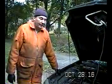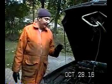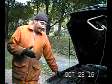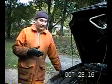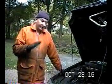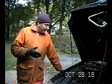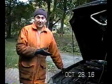So, okay, I have removed all 10 head bolts from the car, and all of them look surprisingly good. I didn't see any aluminum shavings. They were really remarkable. And just because I'm not really sure what to expect and how long this car's really going to last, the body looks like shit. It looks like it's got leprosy anyway. I think I'm just going to go ahead and put the regular head bolts in. Now, I know there's a bunch of people that are going to get pissed off when they hear that. They're going to say I need inserts or studs or whatever. That's true. But just for this job, just for shits and giggles, I think I'm just going to go ahead and put regular head bolts back in, torque it down, and if I have to do it again another year, then fuck it. I'll do it again. But the good news is I didn't see any aluminum shavings on the head bolts, which gives me encouragement that maybe the threads are still good on this car.